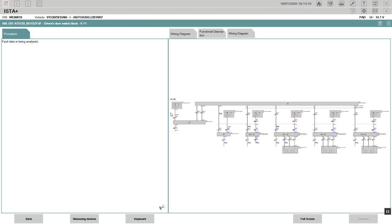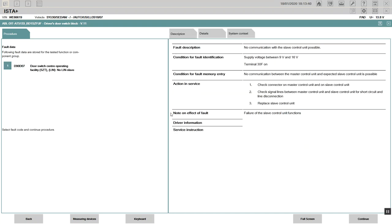So it says CAN communication line can be damaged. Yeah. Right? So what I have to do, I'm going to have to check the harness and the bumper. The battery sensor. Is there a battery sensor that was damaged? The one that was on the negative terminal, we had two small wires that should push it.